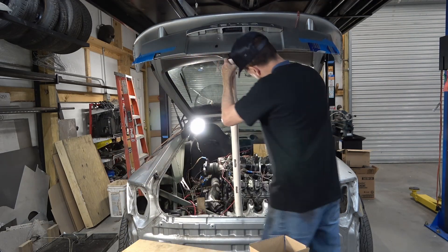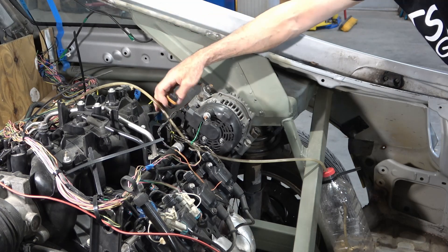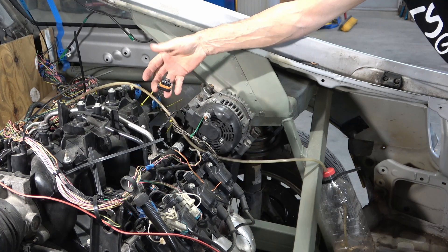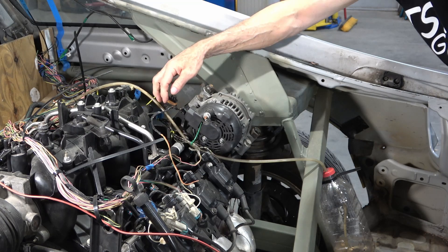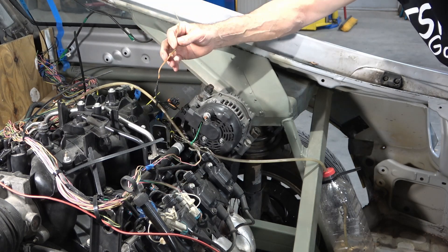What I've got to work with over here is this: the original plug for the LS4 alternator — the plug that was for the alternator that was on the truck. It's a three-wire plug. I'm just going to use this plug. I'll probably pull these wires out of this wiring harness because I'm going to run them all the way to the front of the car, completely separate from the wiring harness.